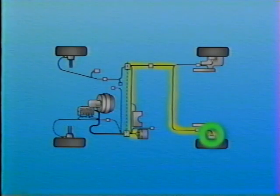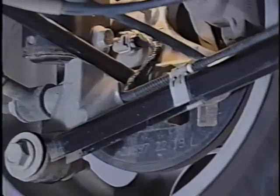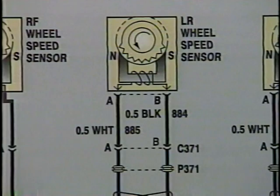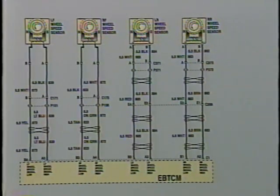Let's say you find a history code C1234 for a short or open in the left rear speed sensor circuit. First, write down the code and its history data, including the number of times it was set. You suspect water intrusion at the sensor's connector, but you shouldn't disturb it yet. This kind of intermittent is often hard to diagnose because it's hard to recreate, and disturbing the connection at the sensor could eliminate your chances of making it reoccur. All you really know is that the module is reporting an occasional open or short in this circuit — it could be an open, a short to ground, a short to voltage, or a faulty module, anywhere in the entire circuit.